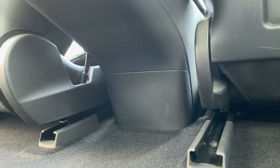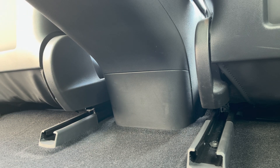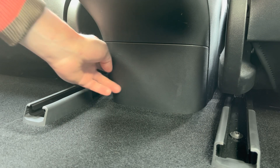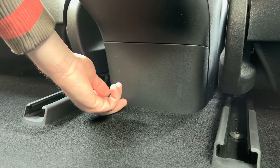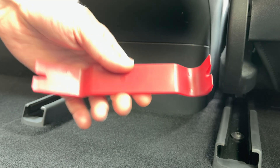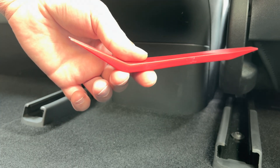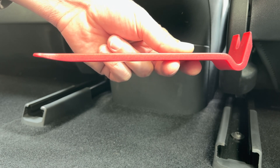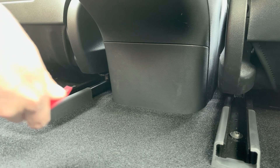To make your life easier, remove the rear floor mats and push the front seats all the way forward. This will give you plenty of room to work on the trim easily. Next, we need to pry this piece of trim off. You'll normally need some tools because it's very tight and hard to squeeze your finger through — something like a trim pry tool.